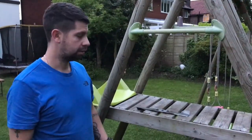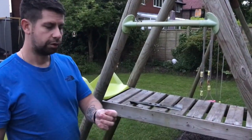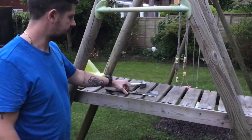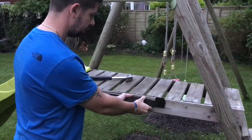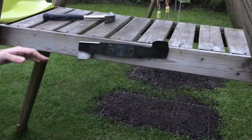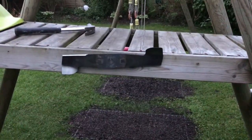The last thing you want to do is balance up the blade — make sure it's balanced. If it's not balanced it will cause vibration in the lawnmower. Just get yourself a little nail, bang it into a piece of wood, and then just put your blade on it. If it tilts down to one side, then you need to grind a bit more off that side until it stays level. That's pretty good, I'm happy with that.